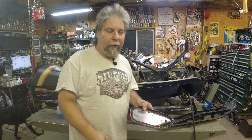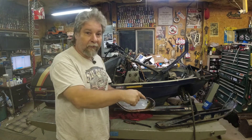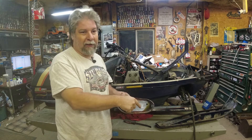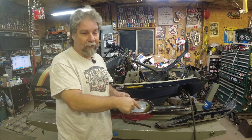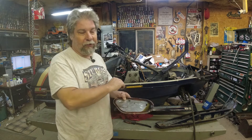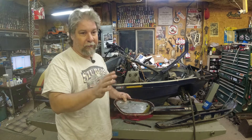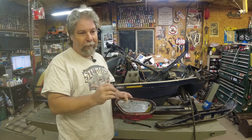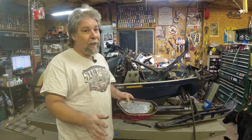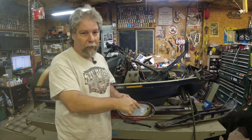Time for a little discussion. This is gear lube — 80W90 or heavier — and this is the wrong stuff for your snowmobile chain case. Do not do this. This stuff is so thick that in cold weather it'll make your chain stretch. The right stuff to use if you're cheap is automatic transmission fluid. Every chain drive transfer case in a pickup or SUV from the 80s into the 2000s used ATF. If it's good enough for those chains, it's good enough for this. Your chain will thank you — it'll last longer. Don't do gear lube.